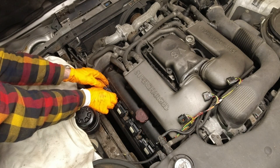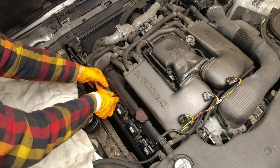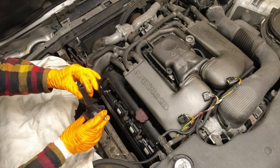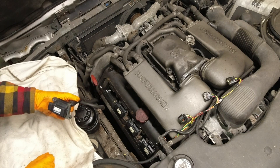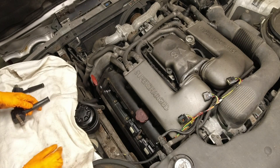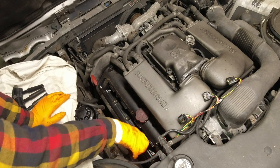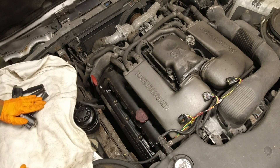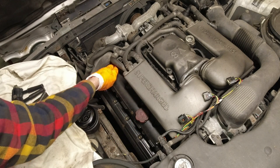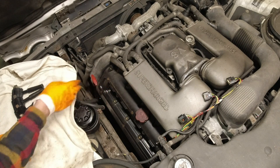This was one of the cylinders with the misfire. We're probably not going to tackle that in this video, but I'm very interested to see if there's oil on it. It's nice and dry — so either a bad coil or bad plug. Really nice and dry so far — all good. Lay them out here. There's just a little line up there; these can all be moved to the side, and the dipstick gets moved to the side as well.